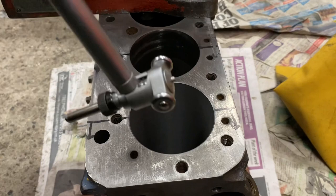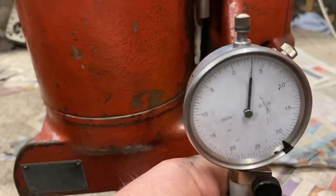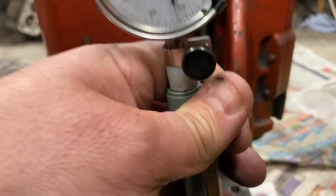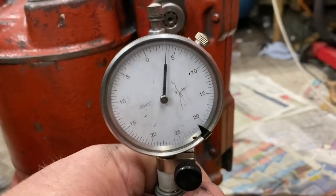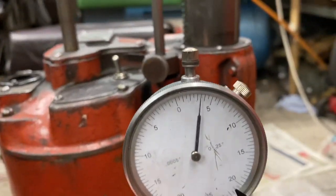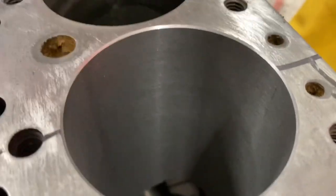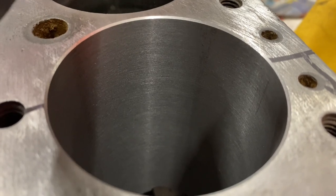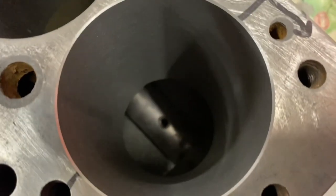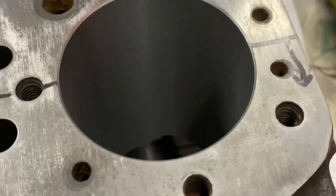So we've moved the boring machine — let's put the gauge in and see what we've got. Going down the bottom first: I've set the gauge so the zero position indicates the final size. We've got a good three and a half thou to hone out, which is excellent. As we come up the bore we can see the machine's done a good job — plenty of material to hone. At the top of the bore it's also about three and a half thou, so in terms of our finish, not too bad at all. It leaves a rough finish that needs honing to final size, and then that rough finish will be taken out by the hone. The main thing is it has bored perfectly all the way down with no damage in the bore. Brilliant — so now we move on to the next cylinder.